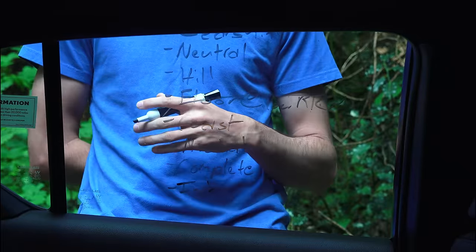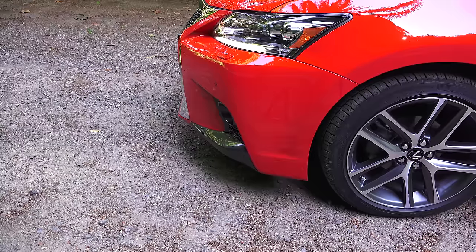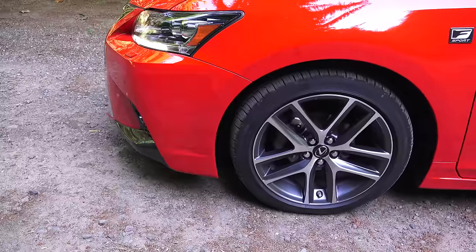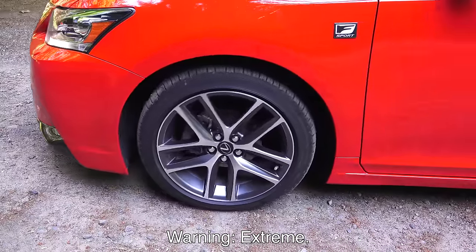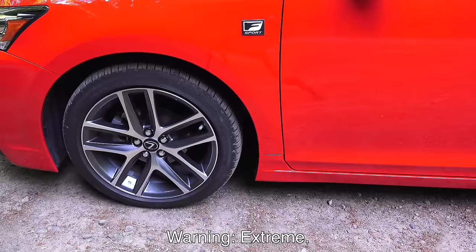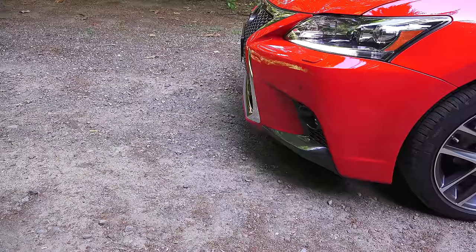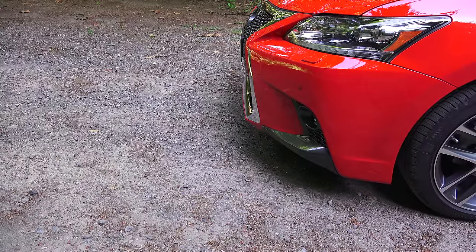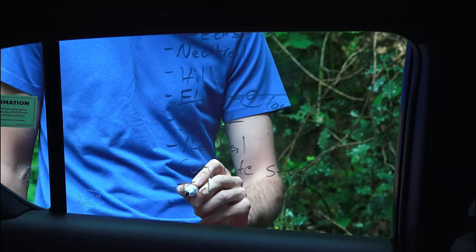Number 9 is about inching. If you just want to inch forward in traffic, most CVT scenarios this isn't going to be a problem. With a traditional CVT you'll have a torque converter that allows for that slip, and with an eCVT an electric motor will inch you forward. The one exception is a clutch-based traditional CVT — that clutch may not fully engage to inch forward, so spending a lot of time inching, going up steep inclines, or towing can put a lot of heat into that clutch and wear it down.